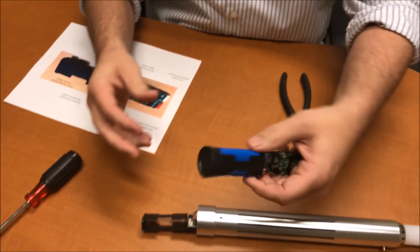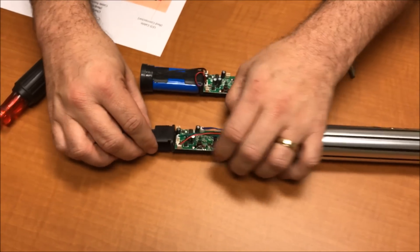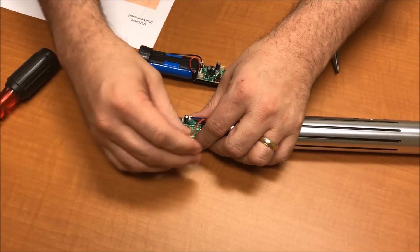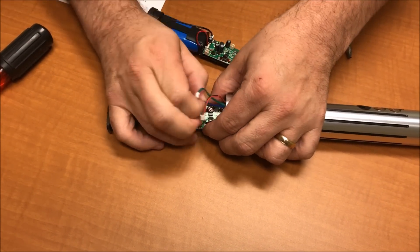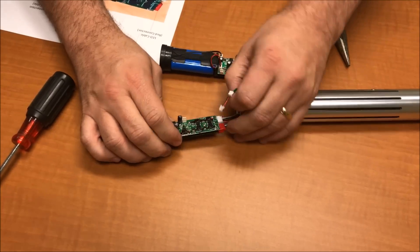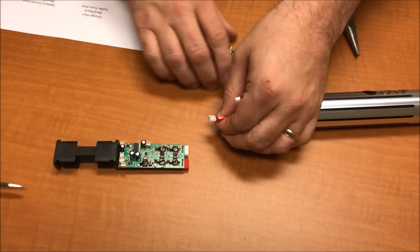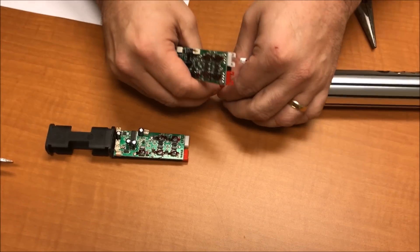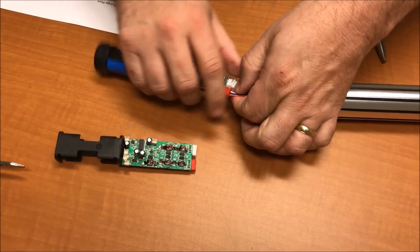There's your battery back in and there's your speaker — just adjust on the side. Now we're going to take off the rest of these connectors, pulling them off one by one gently. You don't want to rip them off, just unplug them. There are two up here — you'll see these two are the LED ones: red and white. So grab your board and plug red on red, white on white.